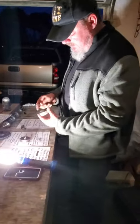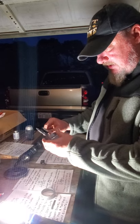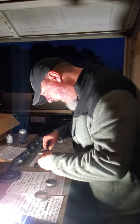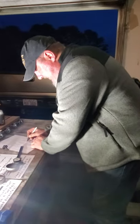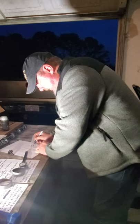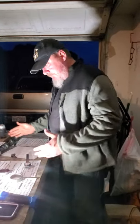So, you take the timing chain eccentric. If you're not going to use an eccentric, you have to measure the thickness of the eccentric, because you need a washer to go onto the bolt. What do we got? 0.070 washer, if you're not going to use an eccentric. So I did the measurement for you, and it's on video. So, covered.